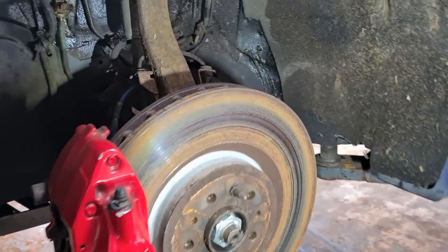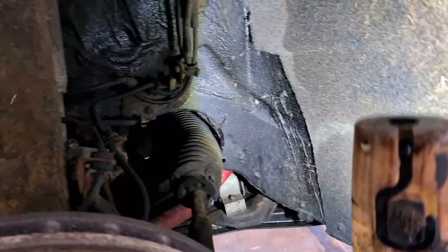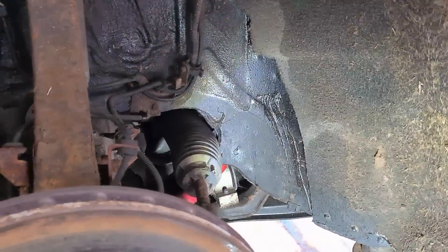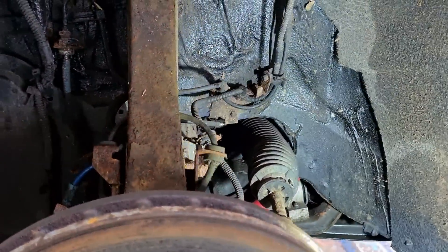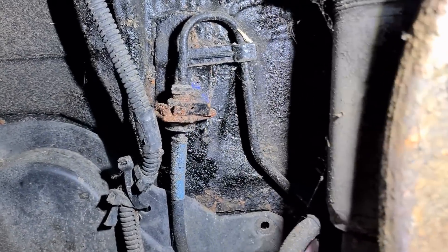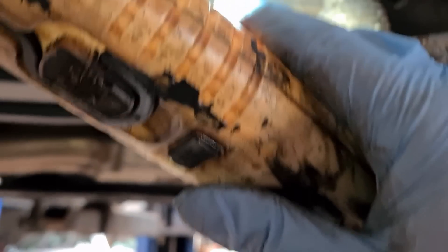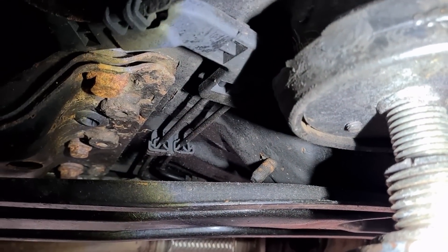If you can see behind the wheel wells, check for rust in the arches, as we are seeing some now where they're starting to rust around there — most enthusiasts will be starting to protect the inside of the arches. Also check for brake pipe corrosion at that point and follow the pipe underneath the chassis — sometimes the cover there is missing and they will start to corrode.